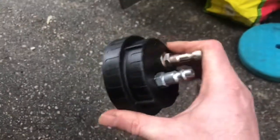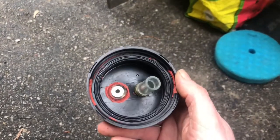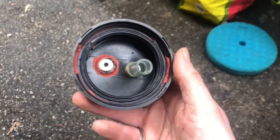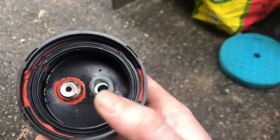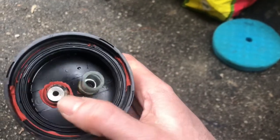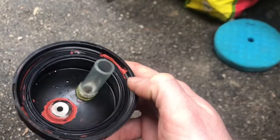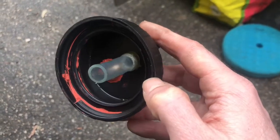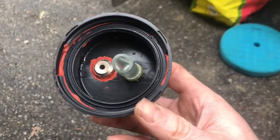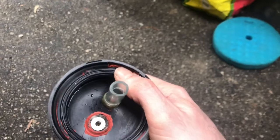Here's your cap from the salvage yard — you're going to need to drill this. The brake cap has a pressure relief mechanism built into it that you need to bypass. You can figure out how it works by taking out the rubber gasket and figuring out how the air makes its way through, then seal it up — I think it was a Permatex product, some kind of anaerobic sealer. You can use silicone in there as long as you make a seal, because those brake caps won't seal up properly unless you seal up the air vents in them.